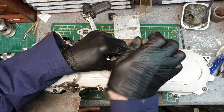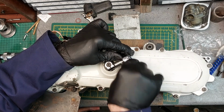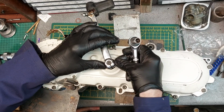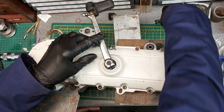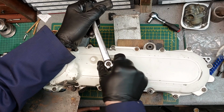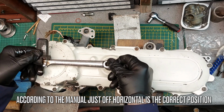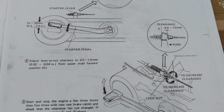Right, remove the 10mm bolt off of the winder handle. That's probably like the other one. Keyed. Some aren't, some are, but Honda tend to have a rounded groove in the shaft that the bolt goes through, so even if the bolt's loose, the lever doesn't come off the shaft. Remember its relative position, but it's quite funny actually. This one's up here. I don't think it's ever been off, but all the ones I see are sort of round here. But anyway, that's okay.